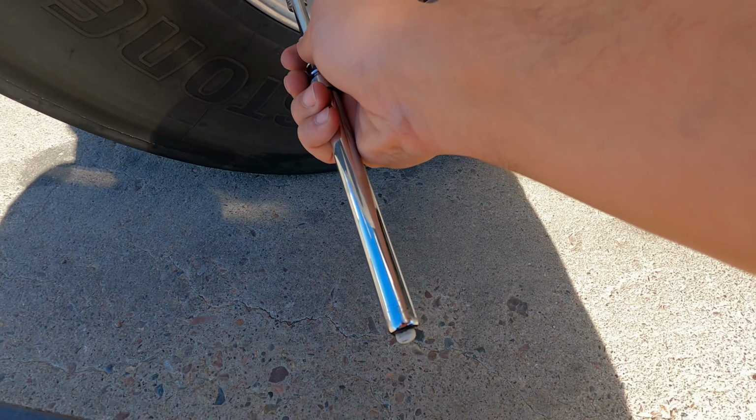The rim is not damaged or bent. There's no welds, no rust, or any powder trails indicating loose lug nuts. The lug nuts are not missing, not loose, not cracked, no distortion. The hub oil axle seal is not leaking, and if there's a sight glass present, check oil is in proper levels.